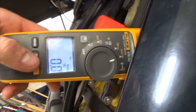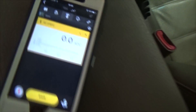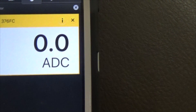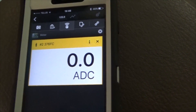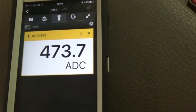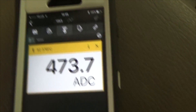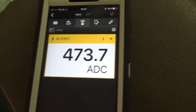We've got the meter in DC amps with the jaws on, going to max mode. It's hooked up to where my starter comes off the battery setup under my hood. Fluke Connect is open. First time around I had the meter backwards so it captured the minimum — this time it should display the maximum current during the start. We started the car: 473 amps to start it. That'd be interesting to see when it's cold since the engine's warm right now, but that's for another day.